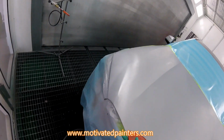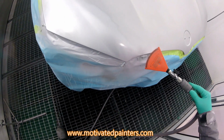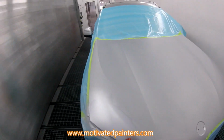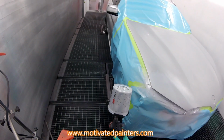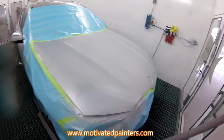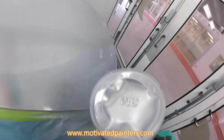I'm going to try to keep this video going as I do it. It's pretty humid today. Like I said in a previous video painting the Mini Cooper, I've been putting 493 in all my mixes because I don't want any issues with peeling or anything like that. So I'm gonna do 20, and put on a nice heavy even coat, okay?